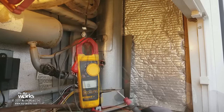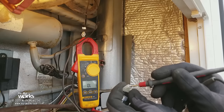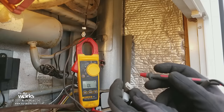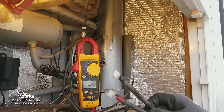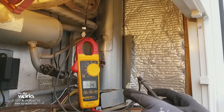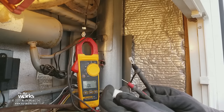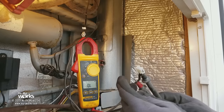So what we're going to do is put the multimeter in ohms — the omega horseshoe symbol. We know we're looking for 44 ohms. What I like to do is come in from the back side of the connectors, because coming in from the front side can separate them a little bit. Polarity does not matter when you're testing ohms for heating elements. So plugging in on the back, I'm getting a value of 42.4 ohms and the spec says 44 ohms. Now, just a side note — there's nothing wrong with this heating element, but let's pretend.